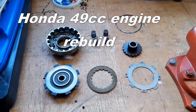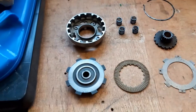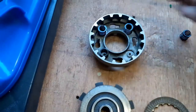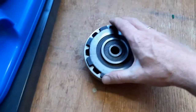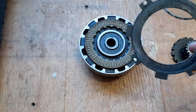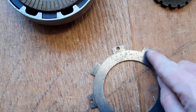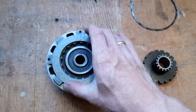We're in a different setting because I need a larger vise to compress the clutch during assembly. I need to put these four clutch springs in like this, then the outer pressure plate goes in. Then comes the friction plate — always look for marks on the inside. The outside has marks from the previous friction plate, and you can see the marks where the lock ring snap ring has been. I can't do this with one hand, so I'll pick you up when everything is fixed in the vise.